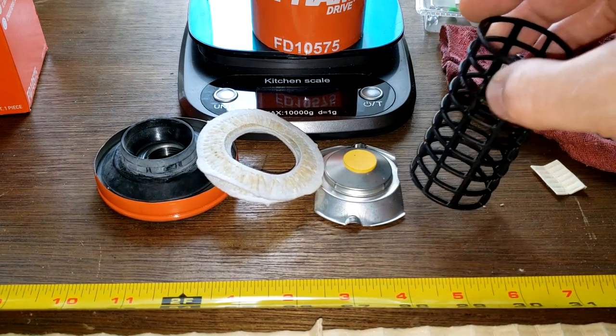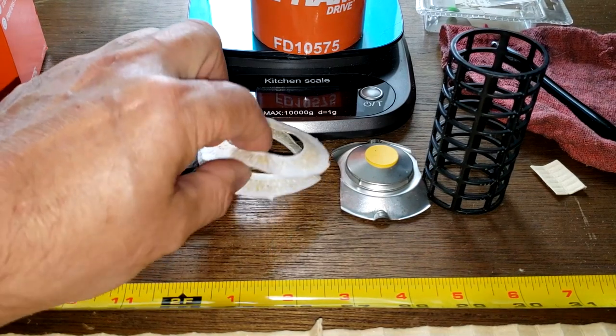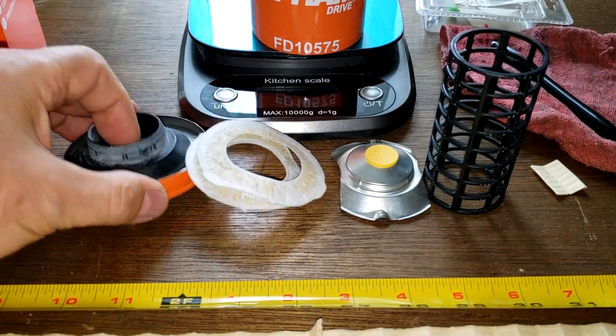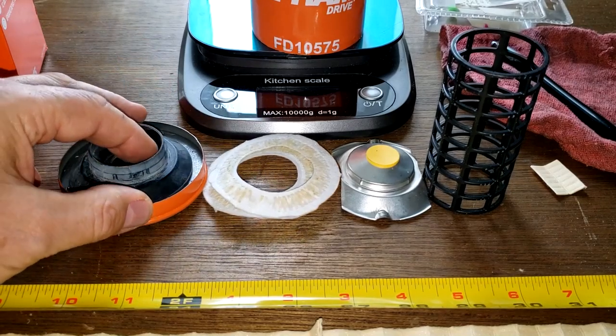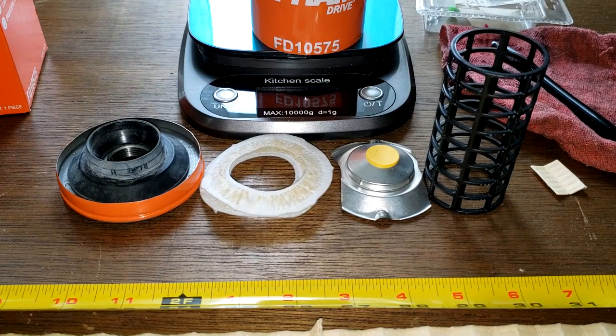You've got your plastic inner cage, stamp leaf spring, felt end caps, thirteen holes outside, eight there. This is looking more like a champ-made filter, and I think that's what it is. So if you're going to pay $5.49 for this one, you might just go to Walmart and save a couple bucks and buy a Supertech oil filter — because it's probably the same thing.